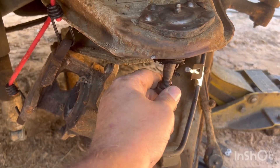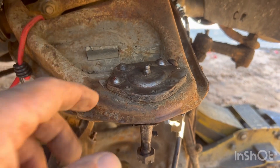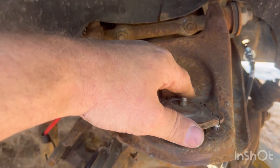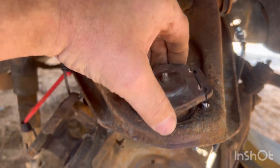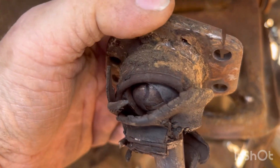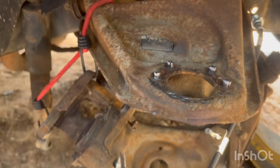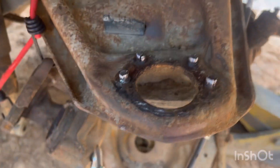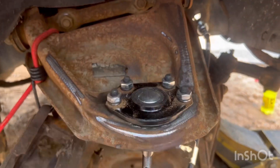They had enough slack we didn't want to use them. Grind off your rivets, and then with a little persuasion and a good hammer and chisel you can get that old gal out. Get your rivets out of the holes, your new one's gonna bolt in, and just like that the new one's in — she's good to go.